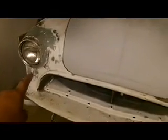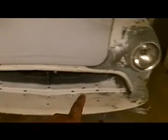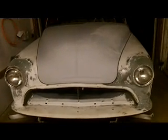So there's the hood. I was playing around a little bit, so what you see there is just me sanding the primer that's on it. That primer that's on it, if you guys look back to one of my very first videos, it's the wrong primer. So that's going to get sanded back down to bare metal. And proper primer is going to get shot on it. Now I have it. I got to finish sanding headlight bezels, both sides. I got to sand on the inside, both sides there. Clean up a couple areas here and here. And scuff all this up. I'll probably even just sand it down to bare metal, all this in here. And sheet this whole entire front. And primer. I got some 2K high build primer. So that's what that's all gonna get shot in the next couple of weeks. So look forward for that.